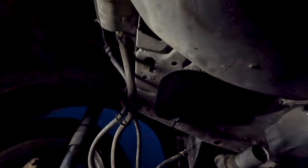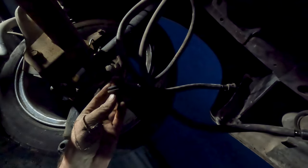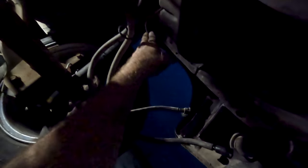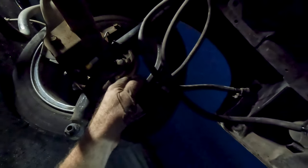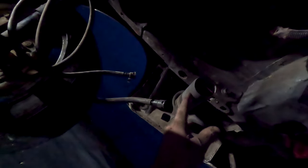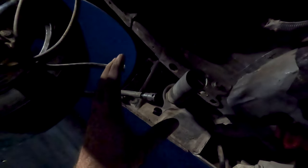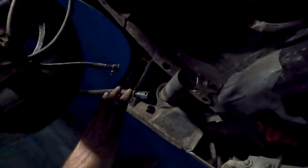The fuel filter will do its job and blow the return out. I'll plug that in and then we should be able to get our gas tank back in here. I replaced the vent cap because the rubber was gone on the vent line that was in this car, and I also swapped out the filler neck because the one in this car was all rusty. That's the nice thing about doing a swap from a donor — you get to pick the cleanest, best items. I'll blow these lines out and then get the fuel tank in using the connectors already in this car since they're in really good shape.